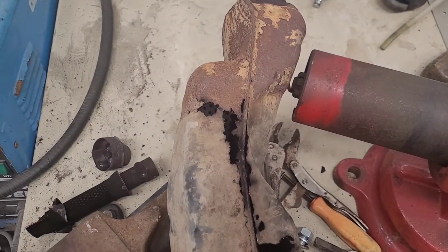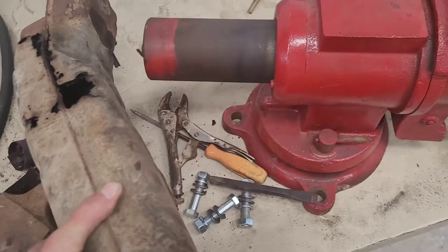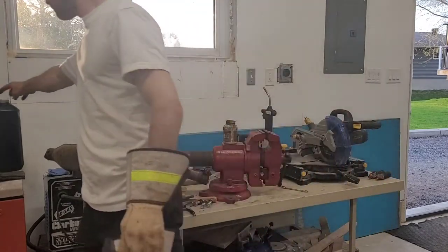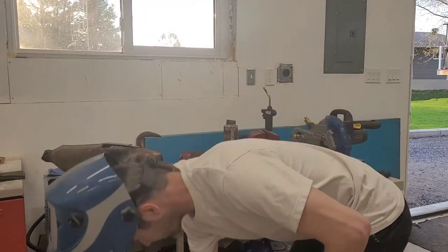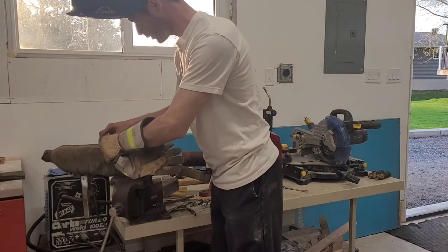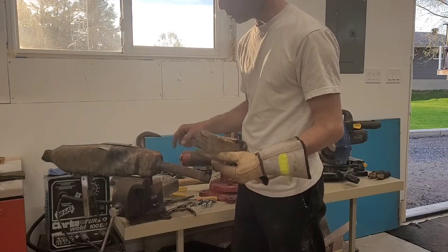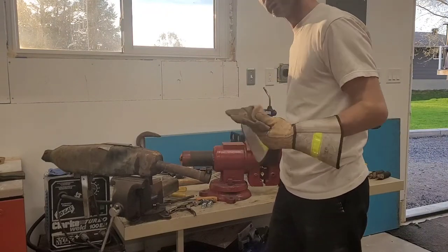I'm going to replace the spark arrester and I suppose I should have just replaced the whole muffler since these are still available from Yamaha, because the muffler is in pretty bad shape. But I am trying to do this on a budget — I'm trying to bring this back to life as I remember it 30-plus years ago. So the next course of action is to put the spark arrester in place, secure it, and do some quick welding. Before you do any type of welding, make sure you've got nothing around like empty cans of oil. I've taken little pieces of tin, molded it around as best I could, and I'm going to stitch it with the welder.